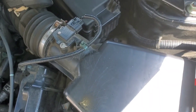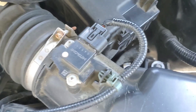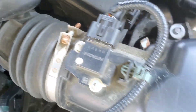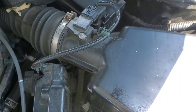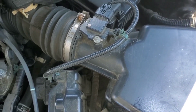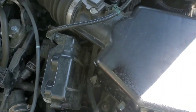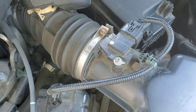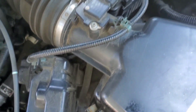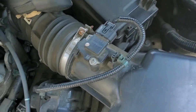It's easy to get to, take off, and unplug. There are normally two bolts — two Phillips bolts on this — very very simple. Just push the little plug, the plug comes off, take the two Phillips bolts off, and the mass airflow sensor comes out. Once you have it out, you can clean it — they have a mass airflow sensor spray. There's a little part that heats up; spray that part, pop it back in, and see if it runs okay.